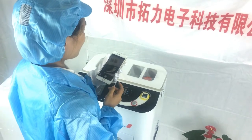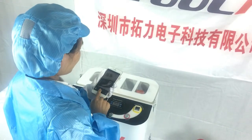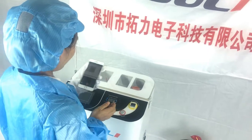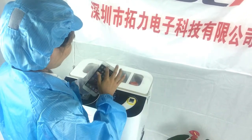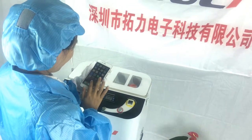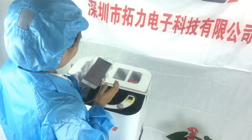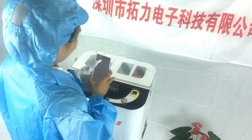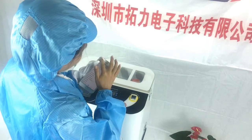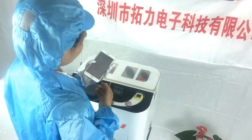When you get a mobile phone from a customer, you need to check this data. You can take a photo and check whether the camera can work, and check the Wi-Fi. You can call your family to check whether the phone is okay. Check whether the glass is broken or not, and check the appearance. Make sure all these are okay before you start the nano-coating.